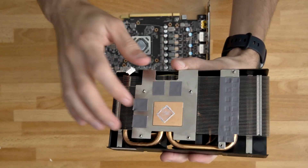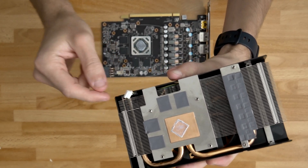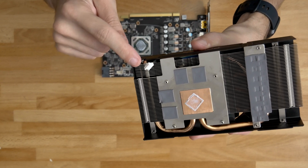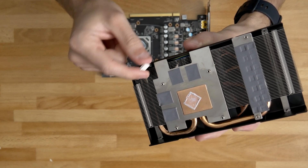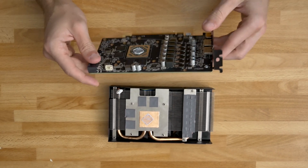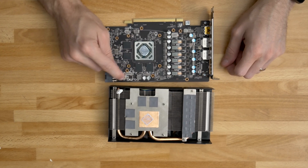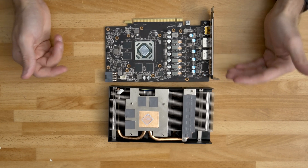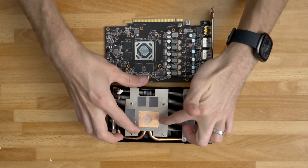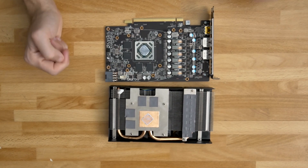I was more concerned about the memory modules, to be honest, because this is not a high-power card. You may have noticed me struggling with the fan connector — this thing was really in there. If you're taking apart a card like this, be careful, because you can pull wires out of the housing or actually break off the header itself, which I have done with LED connectors. So this is the basic teardown: we have adequate cooling on the VRM, good cooling on the memory modules — great to see in an OEM card — and a copper cold plate connecting to the GPU. Let's get that cleaned up.